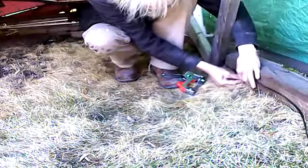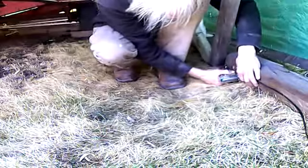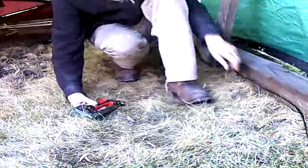I'm going to be working in this boathouse. Goal today is I'm going to get a security camera on the inside of this boathouse. Okay. Camera is mounted, so that's better, that's what we want. Okay, now I'm going to get the stapler out, and we're going to staple this down along this post, along the base of here. We'll come on the lower side up from this point, because we will be going underground at that point. Plus, when the grass grows up, it's going to hide it.